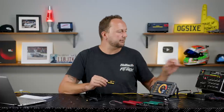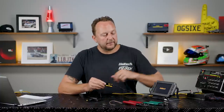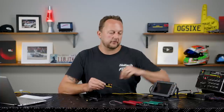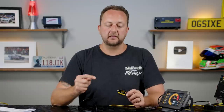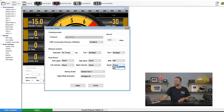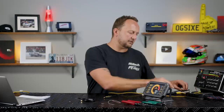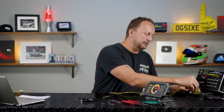To get it out of test mode, power cycle the ECU or unplug and replug the GPS puck — off, back on again. When the dash powers back up, the speed in the bottom right-hand corner will be at zero kilometres an hour, telling us it's come out of test mode. But that's not the end of this video. Let's take the speed signal out of the dash and wire it into our Elite 2500 series ECU to show you how to configure the software. While I've got the IC7 software open, I'll go to System, change my speed from Direct back to ECU, press Apply, then send that into the dash. Remembering I'm about to pull the speed pin out of the dash and wire it directly into the ECU, then we'll open our ECU software.